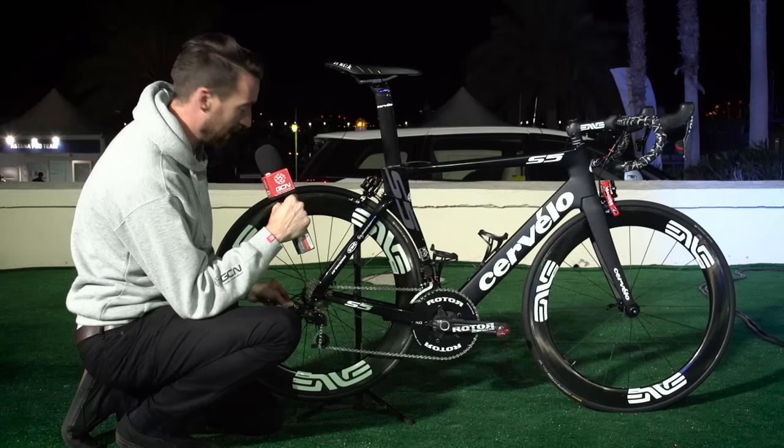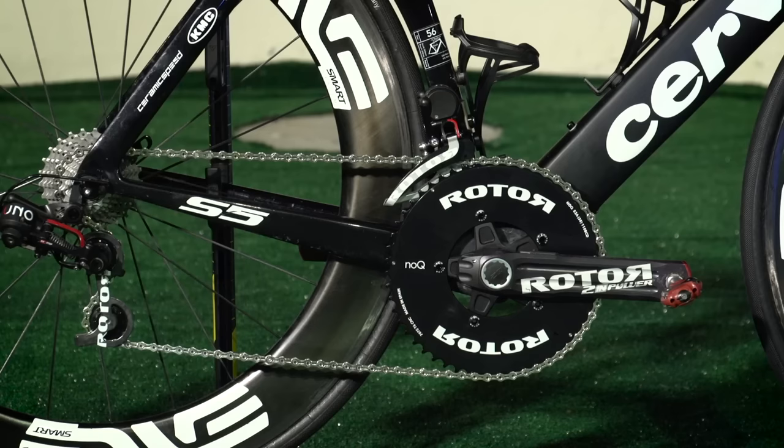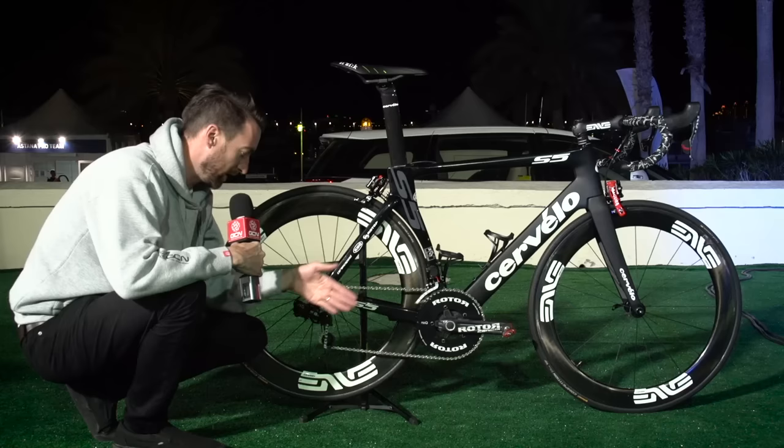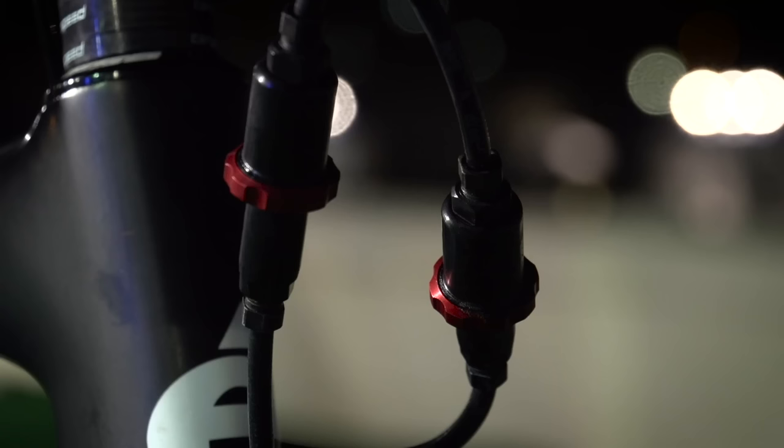I've just been talking to the mechanic about how you go about indexing the rear and front mech. This one's got a few different bolts on it. First of all, there's one that adjusts the left-right position of the mech just for indexing. The other interesting thing about both the front and the rear mech on this groupset is that there are no stop screws — those being the things that prevent the mech going too far in or too far out, maybe going in between your frame and the cogs, or even between your spokes and the cogs. Apparently you don't need them, because all the adjustability is somewhere up at the front. One day we'll get our hands on some to find out.